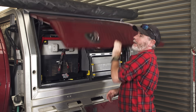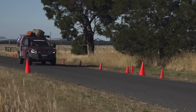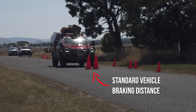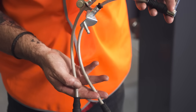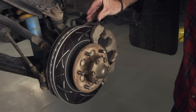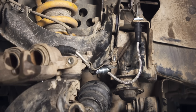If you own a modified four-wheel drive carrying extra weight like I do, your standard brakes just won't stop you well enough. The more mass you have, the more friction and clamping force you need to stop your four-wheel drive, which basically means you need to push down the pedal harder to stop quicker. You can only push down so hard though. The other problem with standard brakes is the brake lines. All vehicles come with rubber lines that deliver brake fluid under heavy pressure to clamp the caliper down. The problem with rubber is it's stretchy — under pressure the rubber can expand, which means energy and pressure is not as effective and not being used to push the calipers in.